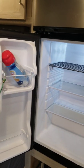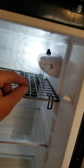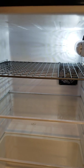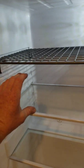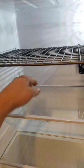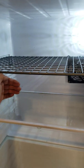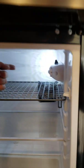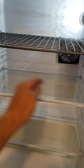The very back of the fridge gets ice buildup, which means it's working great. I did the mod inside where you turn the thermostat about three-quarters of a turn and it helped a whole bunch. I ran it on level three and everything in the fridge was super cold — the eggs in a Tupperware in the back were frozen. So the problem is ventilation: the food in the back is getting frozen, the drinks up front are noticeably warmer, and there's ice in the back. Clearly we have a ventilation issue.